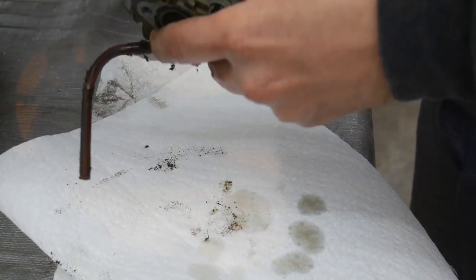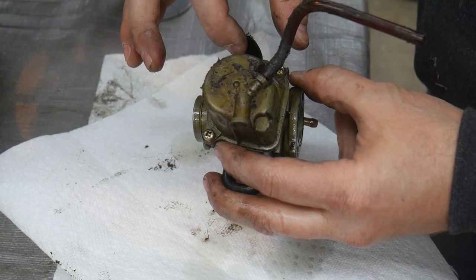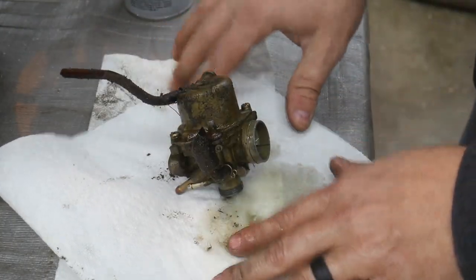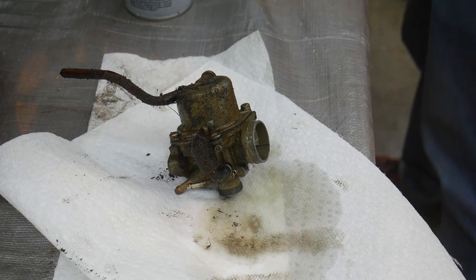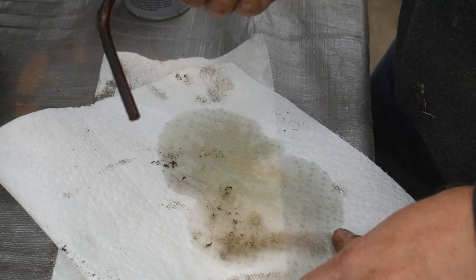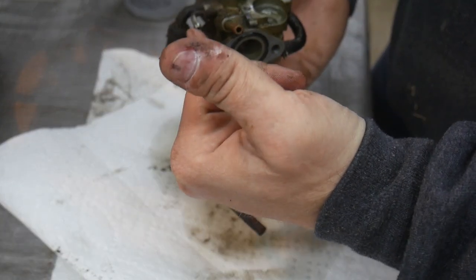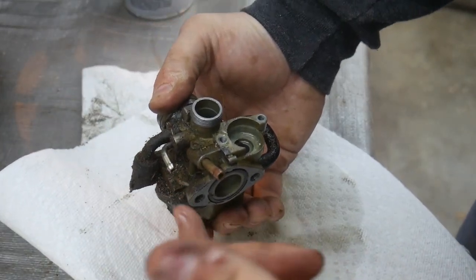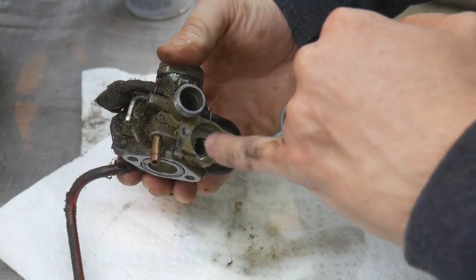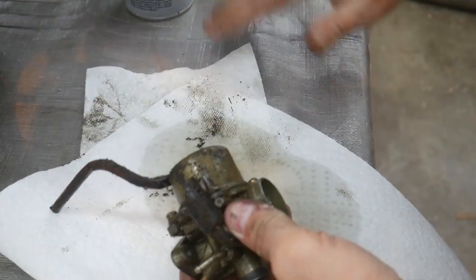On another note, I'm not familiar with this type of carburetor. It's got some weird bypass circuit right here. It's got some type of circuit that's open to the air right here. And then obviously you have your drain here. There's something else going on right here. I don't know if I accidentally yanked it out or if it's just missing. But the fuel line goes here, and then the oil injection is right here. Can you guys see where I'm pointing? Sorry. Fuel line goes straight into here. That connects to the throttle. The oil injection comes into the side of the throttle here. That big black plastic thing that was in here, that's the auto choke. I don't know, let's clean this up a little bit and then take it apart.